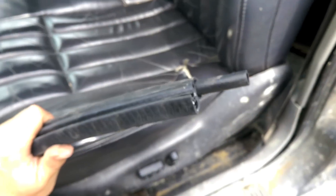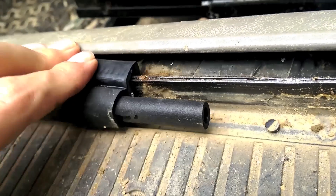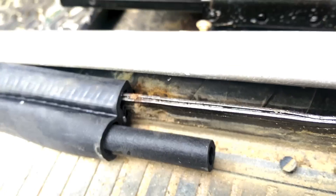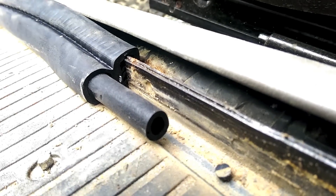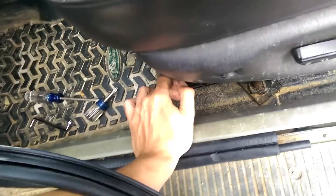When we install this new one, we're gonna want to start with this end first because it's got this little thing that sticks out, and we'll trim the other end to length once the entire thing is on. You'll just push it in there so that the ridges bite down all the way and you've got positive engagement. Then you just work your way all the way around — make sure the squishy hose is on the outside and just keep pushing, working your way down. Getting around the trim is gonna be a bit of a pain but you just keep going.